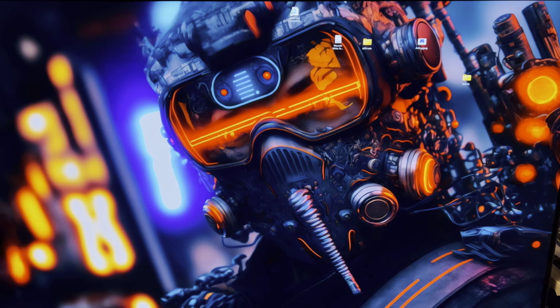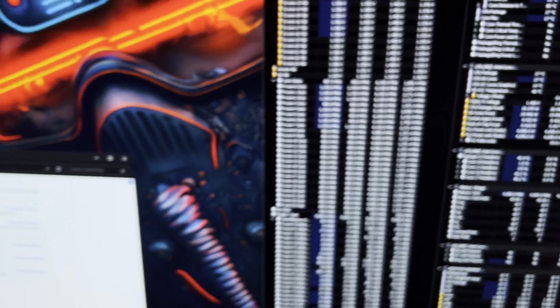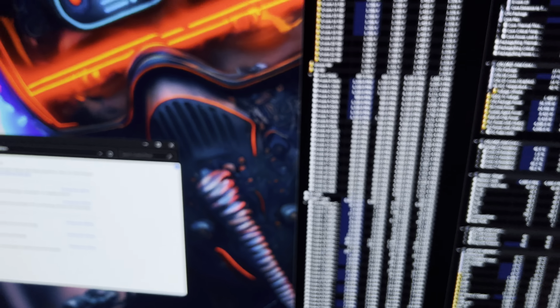We're going to pull up HWiNFO real quick. Another thing that I love is being able to set that, which I believe will work correctly. Yep. So you set your power plan to balanced, and it clocks down all your cores, and it's awesome. It reduces that idle voltage, and the power consumption is just so reasonable. It's like 30 watts right now. That's absolutely realistic. And with dynamic boost, bam, it maxes them out.